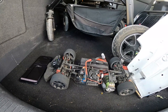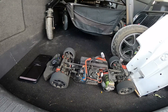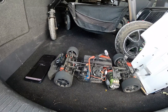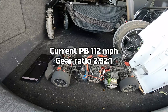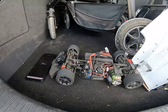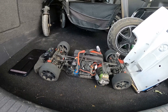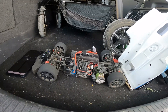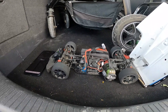It's always a thing of tinkering out. I think we need a stronger ESC. This speed we reached with a much higher gear ratio and a lower motor timing of zero degrees. I think the Mamba X is too weak — we will need a Mamba Monster X8S or so. Thank you for watching.